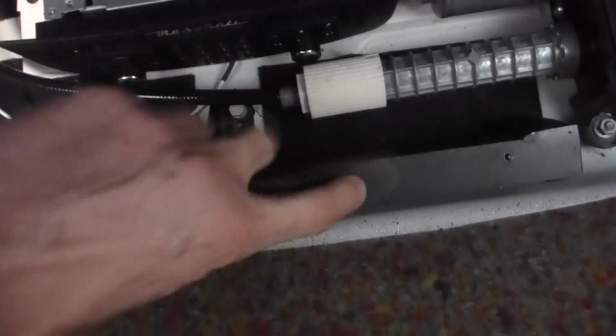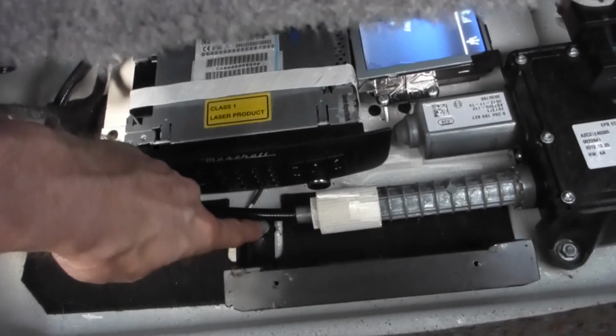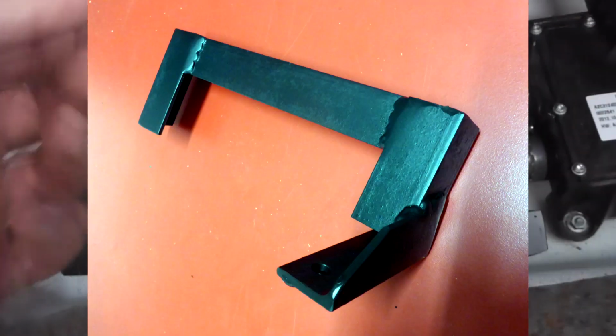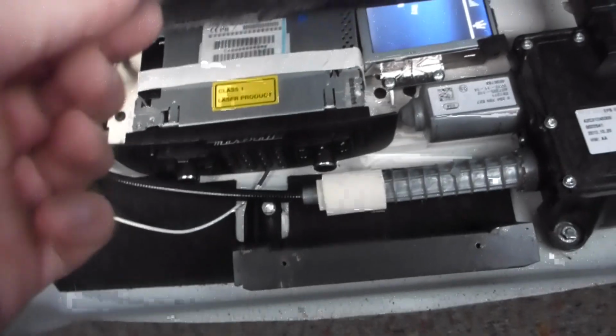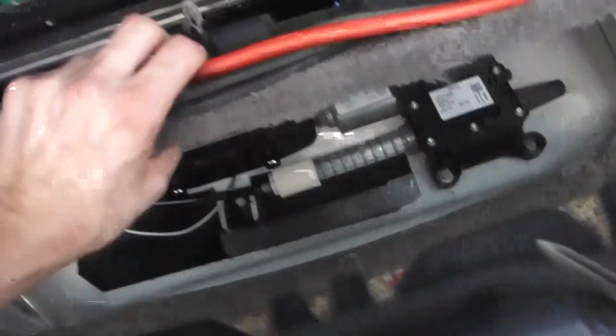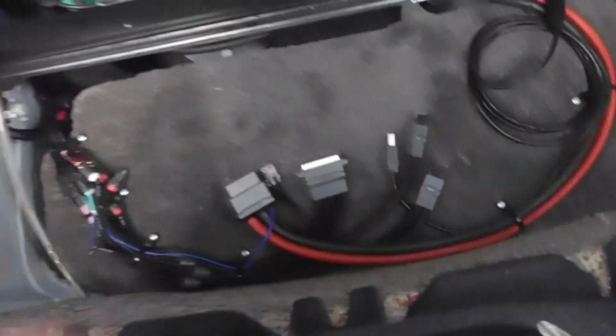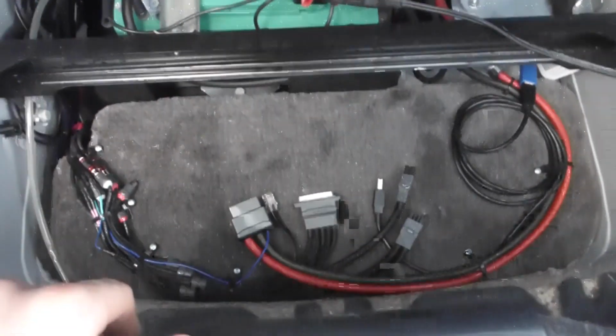Oh yeah, and I do want to show off this super amazing bracket right here, which is perfectly level this way and perfectly flat and level that way against that bracket, which you can barely see. And it utilizes a factory mounting bolt right there. It's all angle iron steel and painted black. And this is the carpeted, black painted on the back, mounting board for the amplifier that drops into place, and then two hidden screws go in there, and the amp drops in there in 1 second.